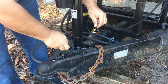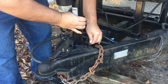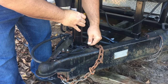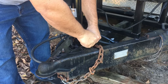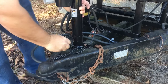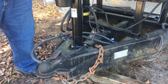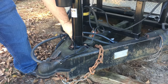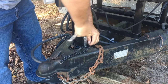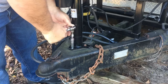Now I'm gonna take my wire - my supplied ground wire that I made - get it under here. It's a tight fit. If you don't grind it and clean it, I could see why you would need the dig-in washers, but if we're doing it this way - getting a good ground the way we've done it - I don't see why I would need them.